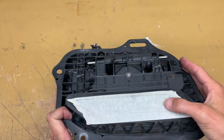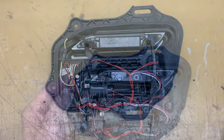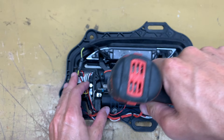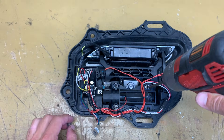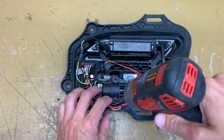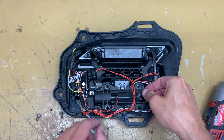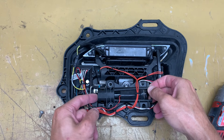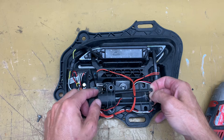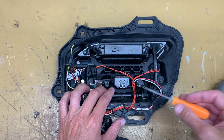Now you can see the handle kind of protruding back and forth. I like to put tape over the front of the handle to protect it. Right here you're going to remove the three T25 Torx screws — there are three of them and they hold on the motor that turns the gear itself. After you remove these three, pull the motor out to the right, because it's got a little collar that it sits inside of on the left. Once you've got that removed, just move it out of the way, and now you have better access to that paddle gear.